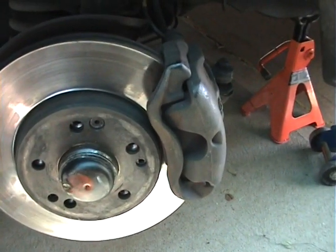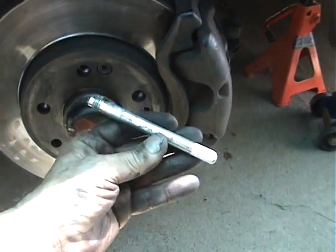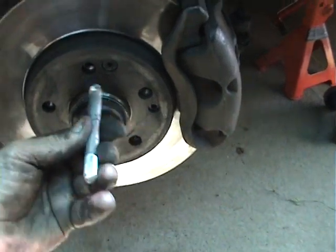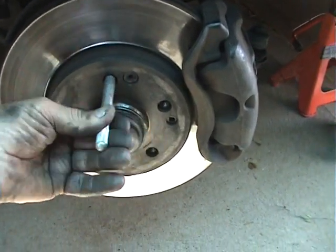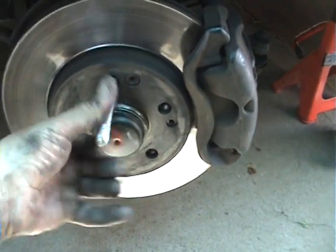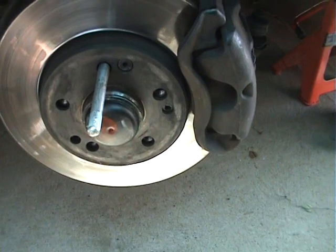I don't think I ever have changed them. Here's an interesting thing for those who might not know: in the tool kit of the car is a little screw thing with a threaded end — that's for the bolts. If you put that on there and put your wheel on, it makes it easier to line up the bolt holes. Just a little tip. Now I'm over and out. Bye.